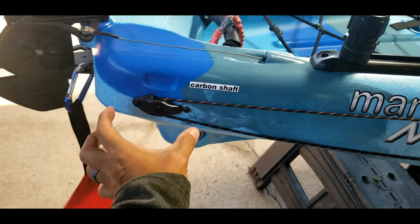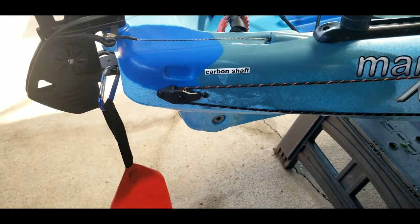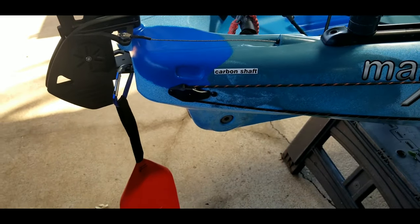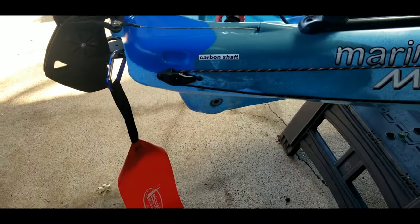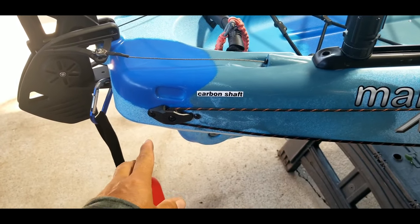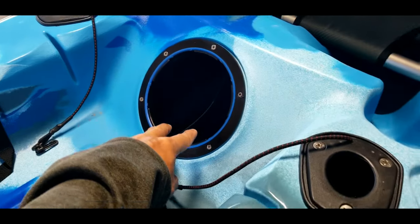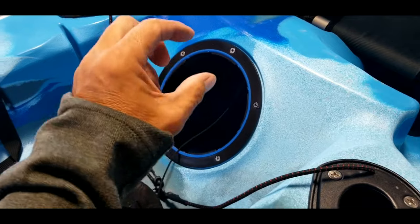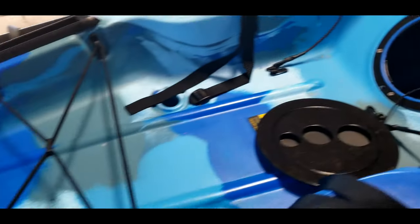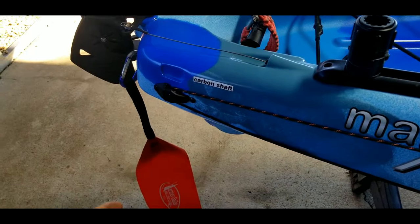The HD trolley includes a backing plate — about that big — behind the pulley system. It seems intimidating at first but it's really not that difficult. First, you drill your three holes using a template, then you take a wire or string — I used wire — and run them through the holes. The wire simply pushes through, and you can reach your arm in through the access panel, grab them out, and put the backing plate on and slide it down.